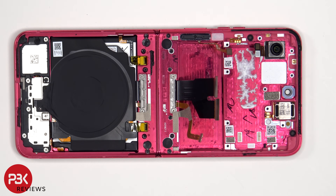For the fingerprint sensor, that also has a cured-in-place rubber gasket, so if you had to replace that, you'd also have to cut out the rubber gasket in order to be able to lift up and pull out the flex cable from the frame.